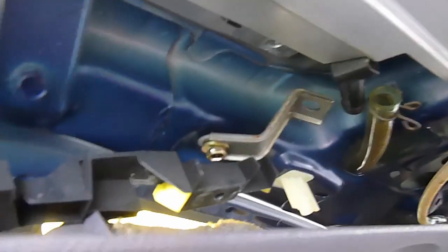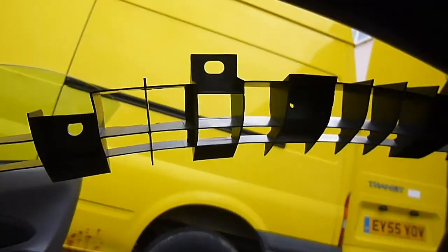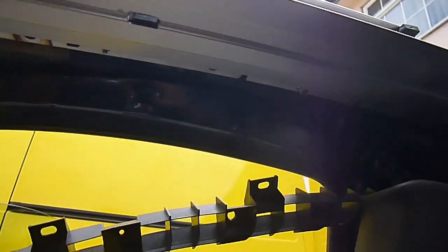There's also this corrugated plastic stuff which holds the side pillar trim — that's got to come off as well to get access to those bolts. It's a little bit fidgety but not too bad. I've done it on this side and it's just hanging off there. I just about managed to get to the end bracket by pulling this bit of trim. We're nearly there — all this is really loose. I've left that bolt in on the middle of the frame and the three brackets are off now, so I'll just do the same on the other side.